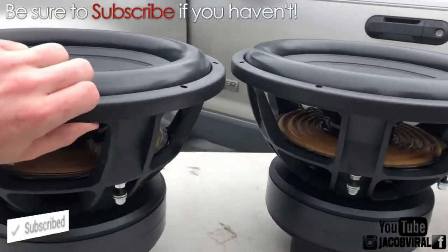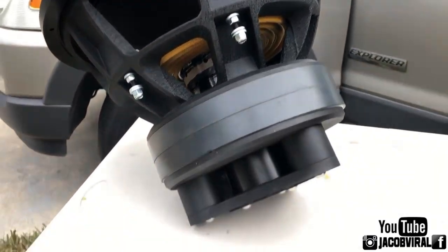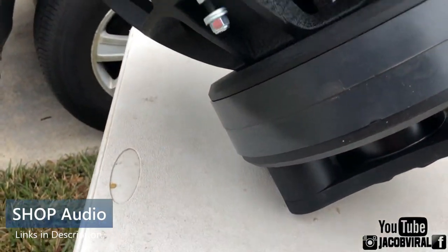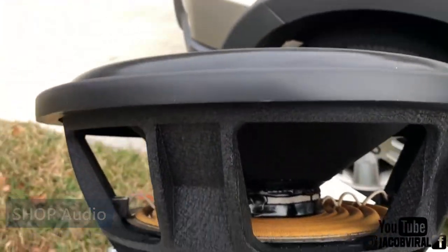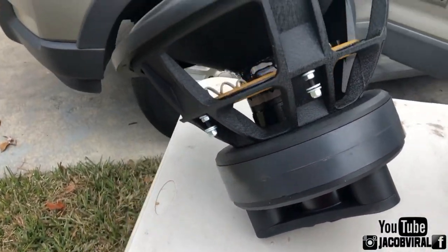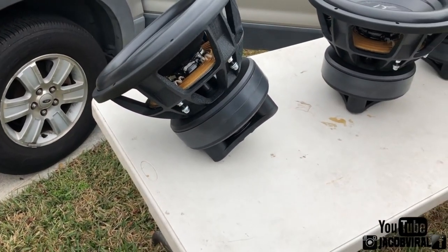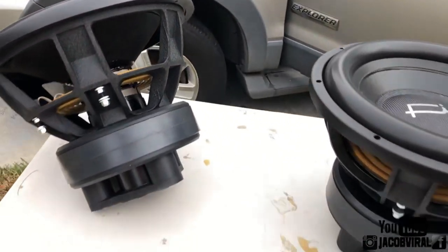So just a little bit of some subwoofer beauty. Y'all can see real quick how they look. Dual ones. I think they read 1.2 to 1.4 or even 0.9. Sometimes it just varies. Have to get them broken in before I can tell you the true spec on the ohm reading. But planning on running them between half ohm and 0.7, for whatever amps I'm coming with. Stay tuned in the video coming later on for what amps I'm running. So there you go, that's how the sub looks. Enough with the sub, now to the enclosure.